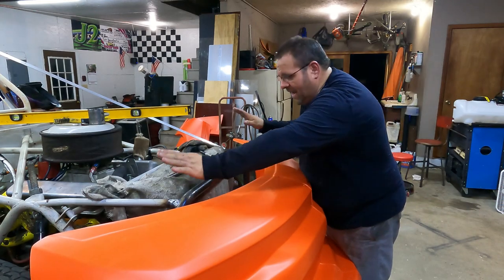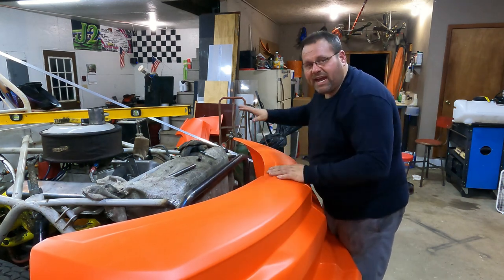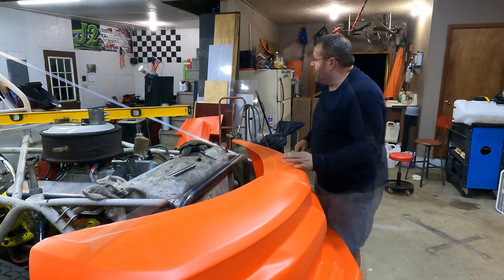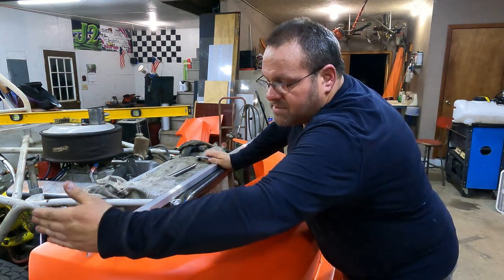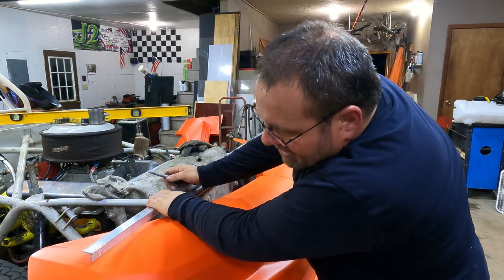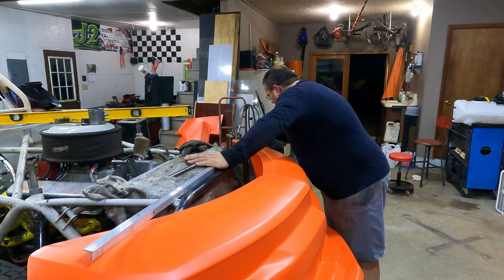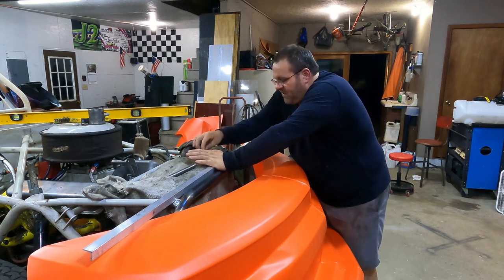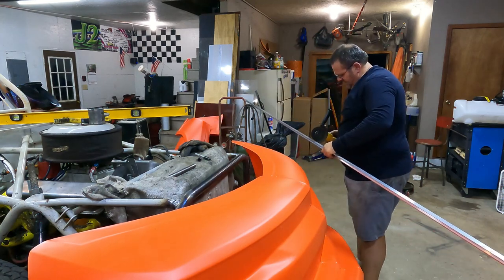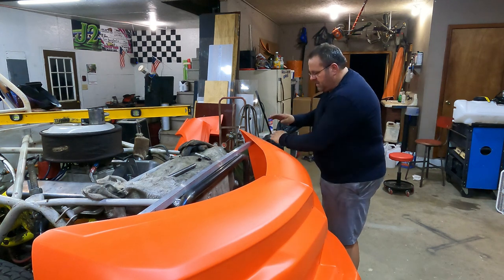We've got our radiator support complete — all welded up, good to go. The next thing I want to do is put the stabilizer bar that goes across here to tie all this together. We can tie our front fenders, and we've got a piece of aluminum that's going to go in here as the filler. I'm going to cut this to length — I'm going to run it right to this inside lip. I'm just literally putting it up there and getting the measurement. I'm going to mark it over here and cut it off, and then we'll look at putting the fixtures to bolt it on, because it's going to be removable. It's going to go up underneath this nose right in here, stretch that nose out, give me that rise I need, and get that flare going.